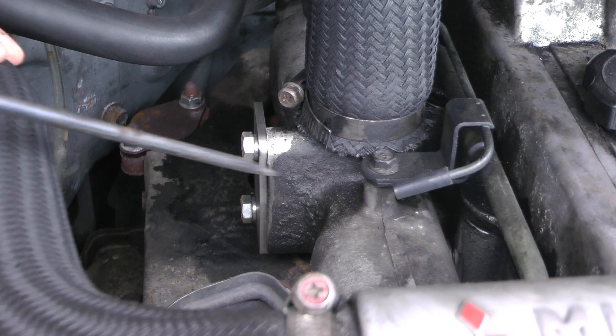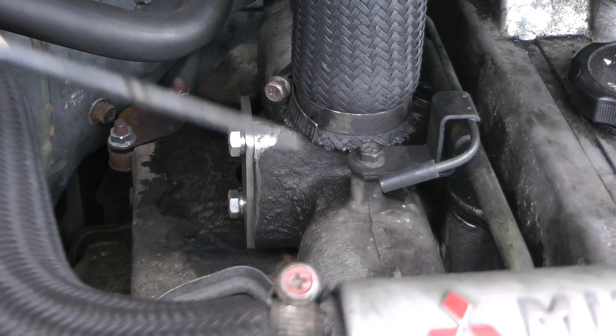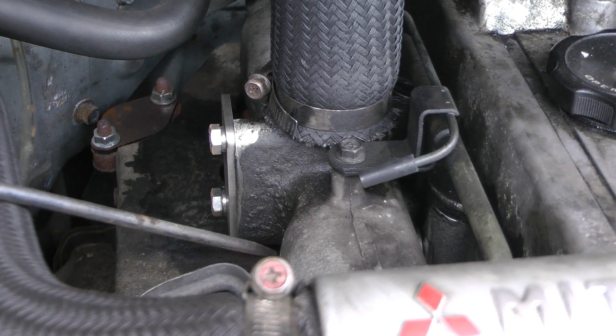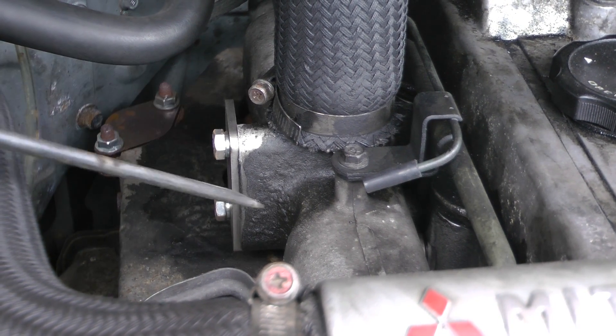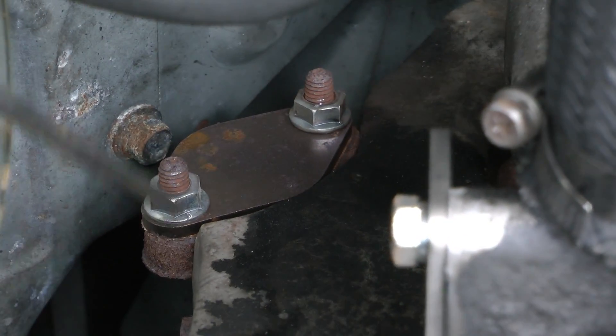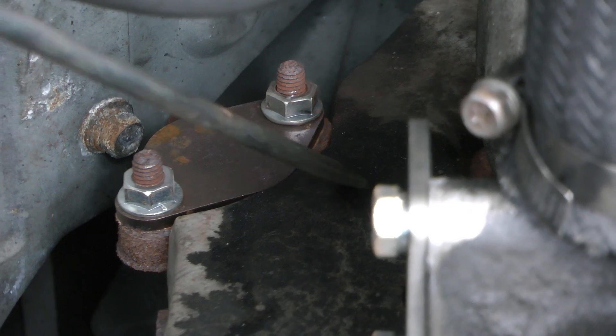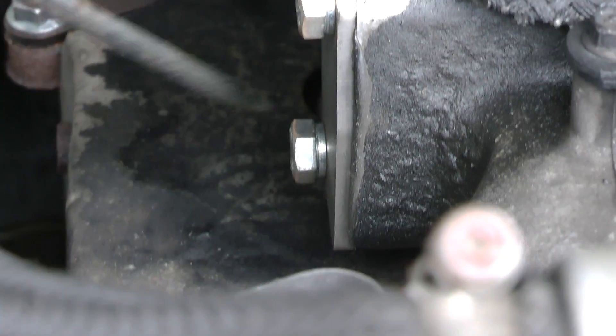This is the inlet manifold, and the EGR passes hot recycled exhaust gases through here and into the combustion cycle of the engine, but it's warm, so it's less dense and less power. It comes out of the exhaust section further down here — that's just been through all the muckiest parts of the engine and is probably oily and sooty. If you look in here, there's all this oil and debris that's fallen out from the pipe.